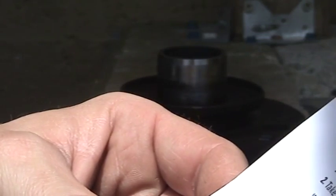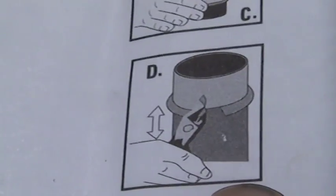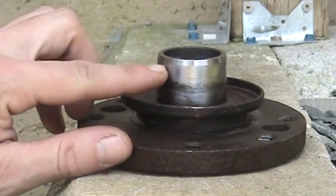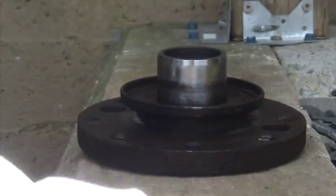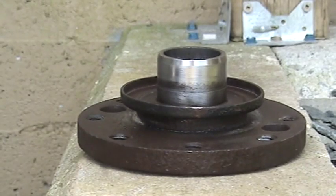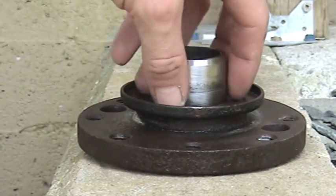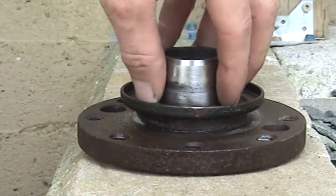Pulling action alone may cause unwanted damage. What that means is if you don't have to go right to the bottom — if you only have to go to here — you've got to cut that lip off. Number eight: keep the repair area smooth and free of burrs. Number nine: lubricate before installing the seal. It also says warning — contents may be sharp — because we're dealing with thin metal. So I'm just going to give this a little sanding, clean it up, and I'll be back to show you how to insert that.